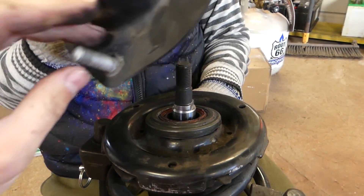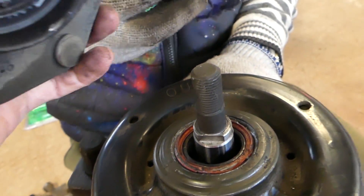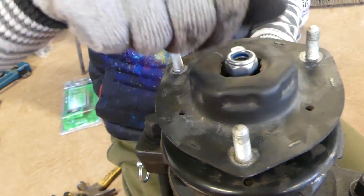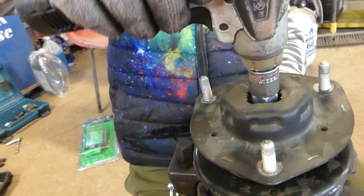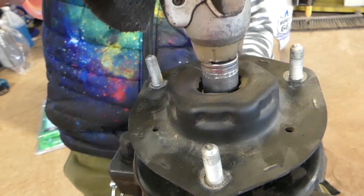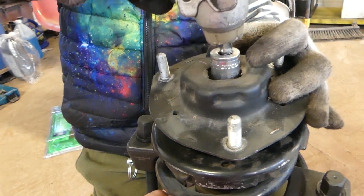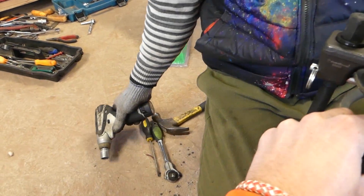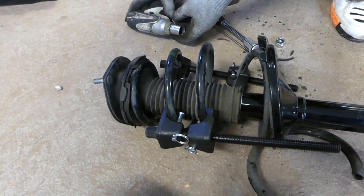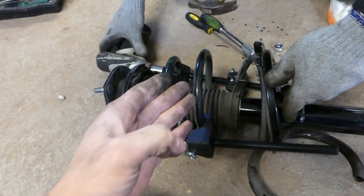The bearing has two arrows — not very visible — but they also need to point towards the outside of the fender. You can see there are two notches that go on the strut, so make sure it lines up there. Now install the nut and get it tight, always keeping your head out of the way. The new strut has a bigger nut. Get it tight, then use the ratchet to make sure it's fully tight once we release the spring. Next, start releasing the spring with the 19mm socket — unscrew a little bit on one side, then on the other.